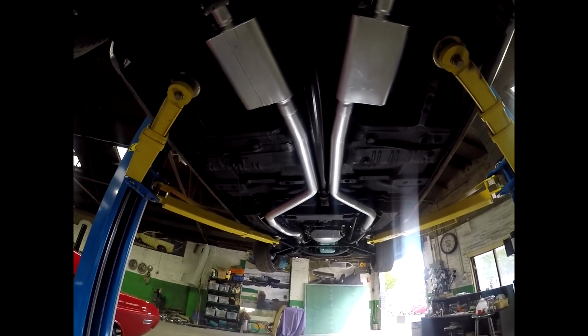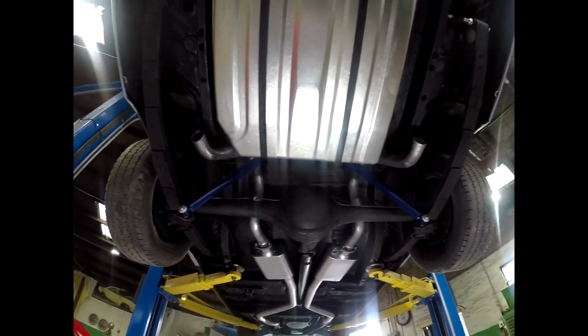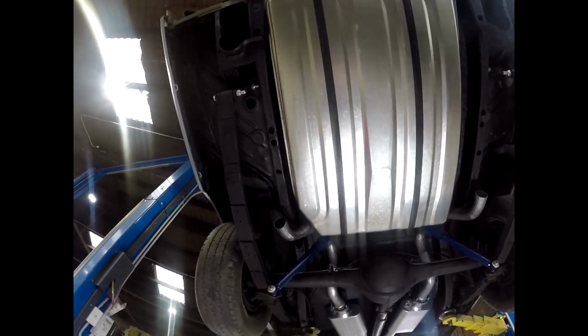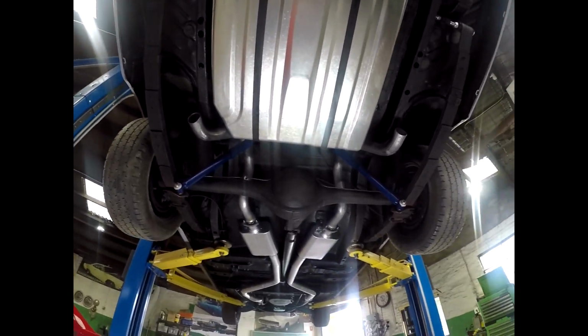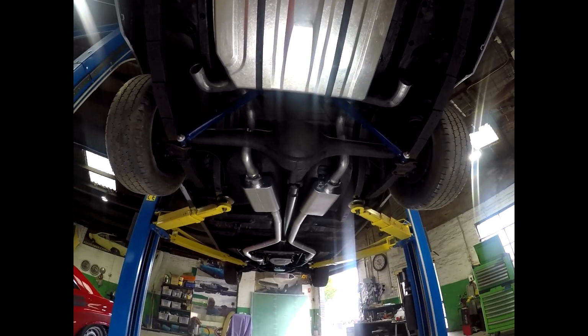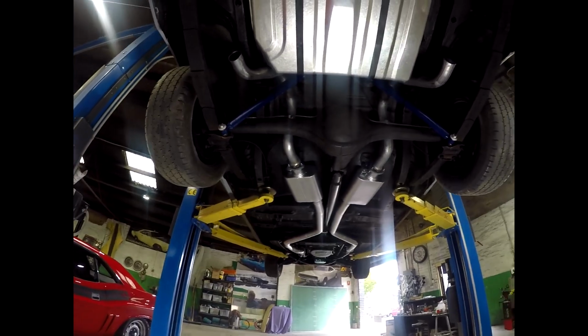So I got my tail shaft in. Also, I haven't made complete tailpipes. I've got them coming out just either side of the tank for the minute, because I think I'm probably going to run some resonators up the back, and then when the rear valance is on, I want to make the exhaust obviously to match that. If you do it now, I won't exactly know where it's going to end up. So the mufflers, the tailpipes aren't finished, but they're as far as I want to go for now.